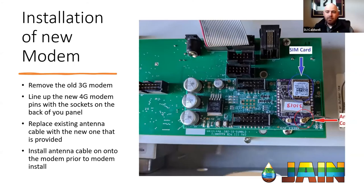After powering down the controller, the first step is to remove the old 3G modem. There's a little post that has a clamp holding the old 3G modem in place. You'll need to remove that — I normally use needle nose pliers to do it. Once you pop that off, your modem is ready to be taken out. On either side, you can get your fingers underneath it and pull it straight out — it is a pin and socket setup, so it does come out fairly easily. There is a little bit of resistance just because everything's tight, but it is fairly simple to pop out.